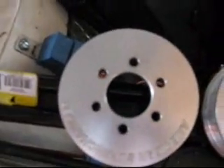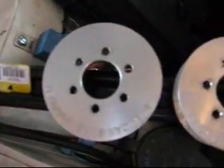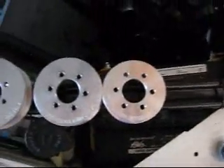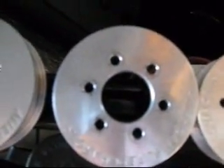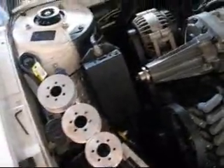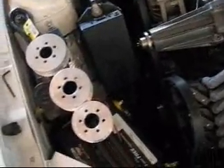I recommend the hub and pulley modular system 100%. It worked wonders for me. I ran this 3.5 inch pulley for a long time, and when I got the funds to upgrade my car more I went down to a 3.2, and I'm going to try this 3.0 with some race gas. That's the selling point of a modular system — the ease of swapping out pulleys. It's a great investment if you see yourself modding your car over the years. If you buy all your big mods on day one, maybe a press-on pulley is fine, but for most people who mod gradually over the years, modular is the way to go.